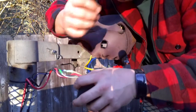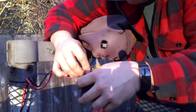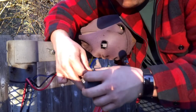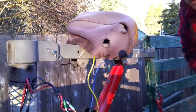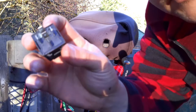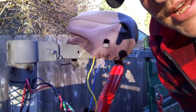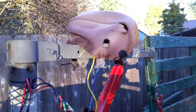Like, oh, no biggie. And I had meant to order more of them. But that was on the up relay. So I replaced that. I was going to order more at the time, too, but I'm like, let's make sure it's the right one. So I order one, and I already got it in there. This is what they look like. They're fairly light. 60 amp, 12 volt, 60 amp, 14 volt DC. Well, the one I ordered is a 6080, and the connectors are a lot bigger, so hopefully it lasts longer.